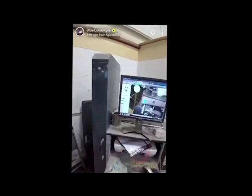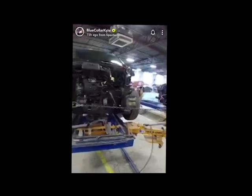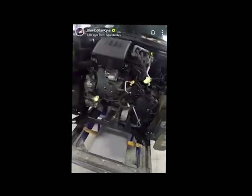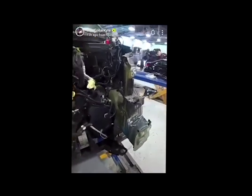Now we're at a positive 3. I'm going to try to get just another millimeter out of it if I can. Should be good. Alright, I got this one all squared up. I'm going to go ahead and start cutting it apart. I have this radiator support piece and this bracket here I got to cut off, and then I will cut my frame rail section.